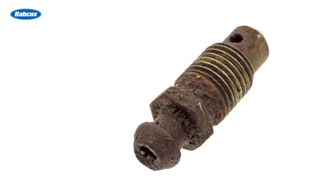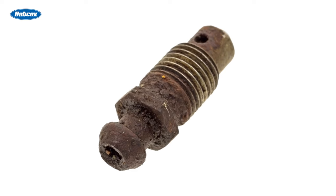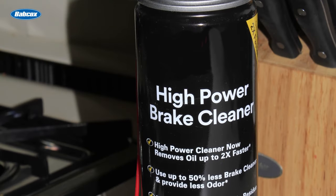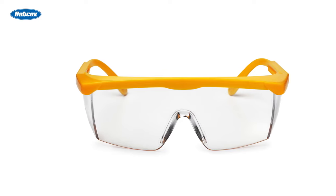The first thing to always do with any type of brake work is check all the bleeder screws and make sure they open. After opening the bleeder screws, it's important to take the additional step of removing and cleaning them. Brake cleaner should be sprayed into one end to make sure they aren't plugged up with dirt or rust. Your customers should always wear safety glasses for this type of job, so be sure to ask if they have a pair.